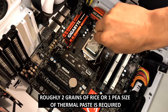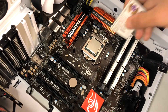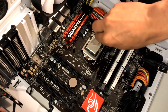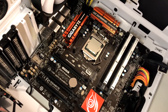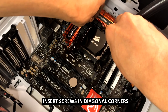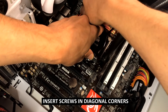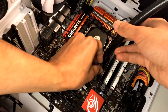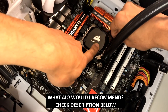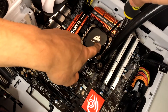After you put the thermal paste, you can install the CPU cooler directly on it and it will spread the thermal paste evenly. Or, like me, you can use a card to evenly spread the thermal paste if you wish to do so. Now install the CPU cooler, position it, and then put two screws in diagonally so it doesn't move. Once you've done that, put the other two screws in again at the two diagonal corners. Once you've tightened those, get a screwdriver and finish the job and make sure it's really nice and tight.